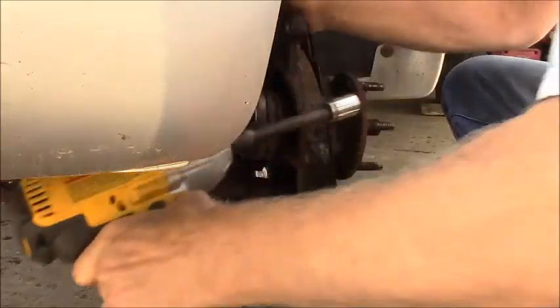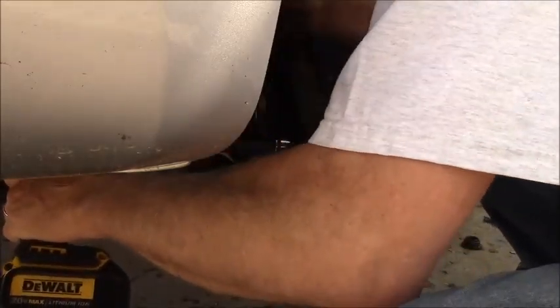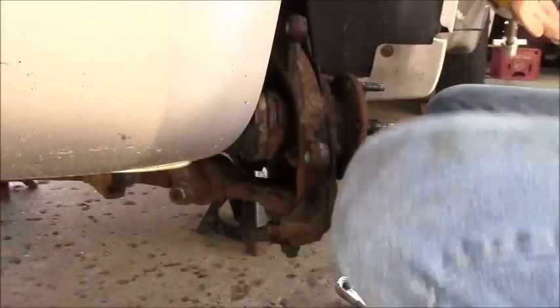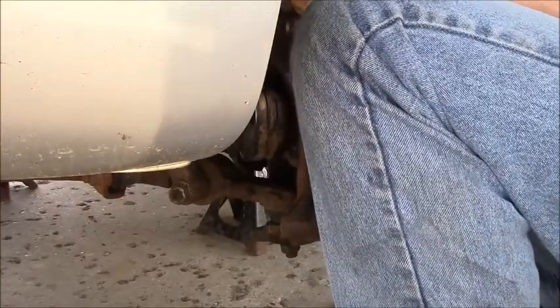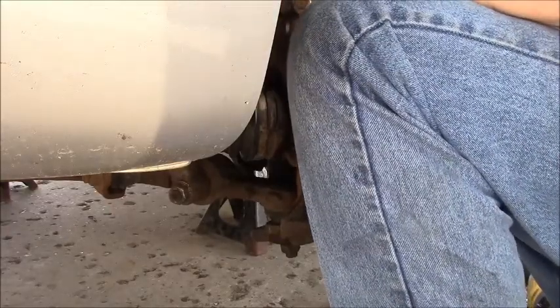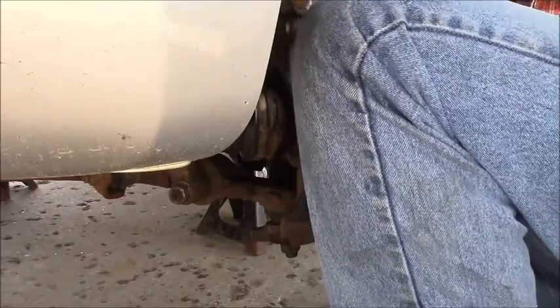The long one's gone. There's one out. The caliper's right in the way, of course. Rotor's coming off. These should probably be replaced too while I'm at it, but I'm not doing it right now. These come off easy enough. It's these beasts that I need to get out. I used a wobble extension to get that bolt. One whack and it's out. Looks like it's got too small a diameter of discs on the front because the pads are wearing way off the edge - that's weird.